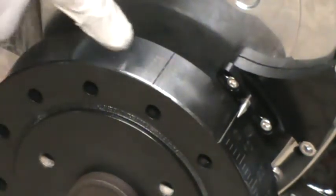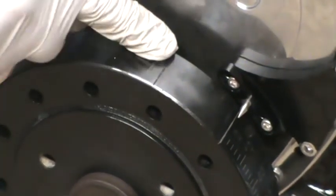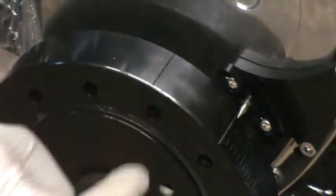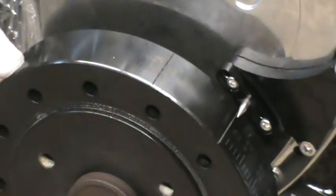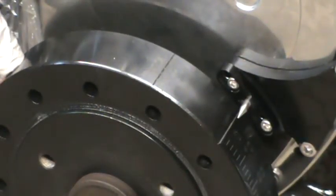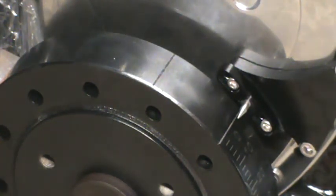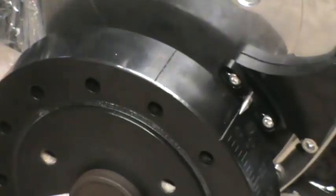This balancer has some other marks on it. It says 'vertical top dead center' — that's vertical, I believe, with the key that's in the crankshaft. And then there are also marks: here is 90 degrees, there's another one over here that should be 180, another one over here is 270, then you're back to top dead center or 360.